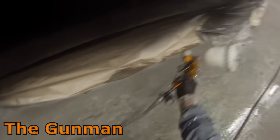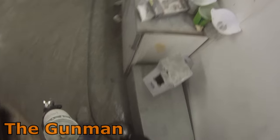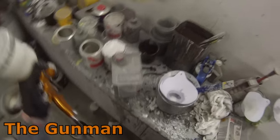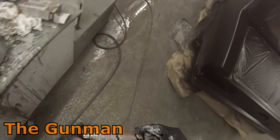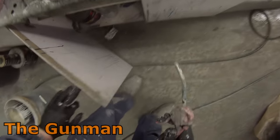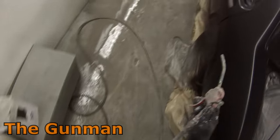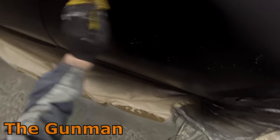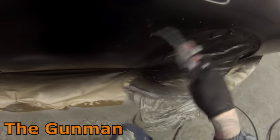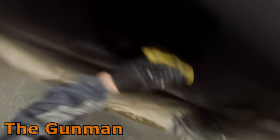In the previous video I mentioned something happened, and that was my reaction when it happened. I was a little bit pissed off because I'd already started getting some clear coat on. There's no real turning back once you've got your clear — you can't just start putting base coat back on. Because of the way my booth works, the air comes in from the left of the screen, from the front of the car, and flows down towards the back end.